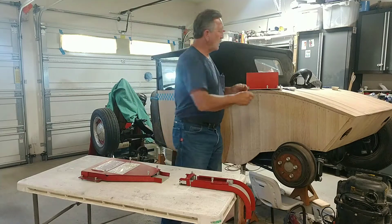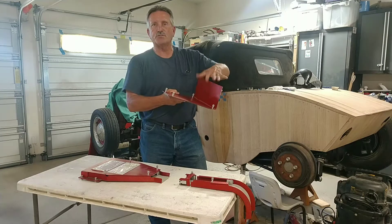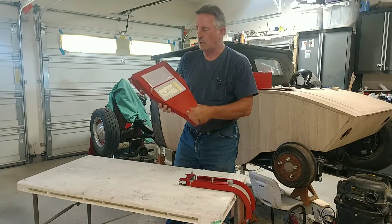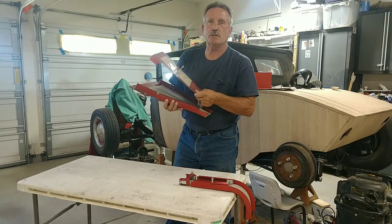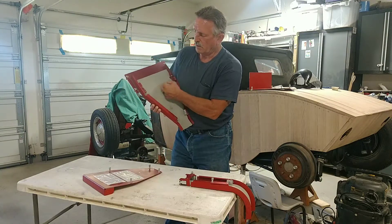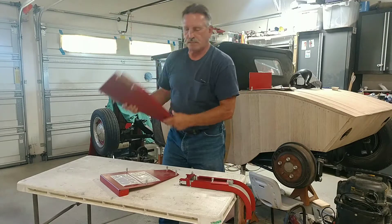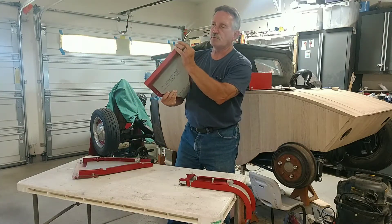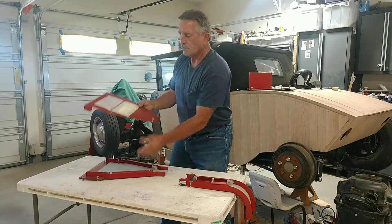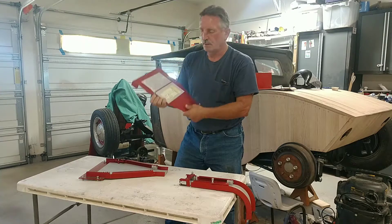The light comes on and I look up there and say okay, I'm going to build it out of this fixture. You can see where I took this piece, put a 90-degree bend on it so I can put some gauges there. This is what it looked like before I started cutting it up — it's just a nice anodized aluminum with a lot of neat hardware and thumb screws. I split that piece off, bent this up, removed these ears, bent this up 90 degrees. Eventually I'll cut a hole here and the shifter arm will stick through.